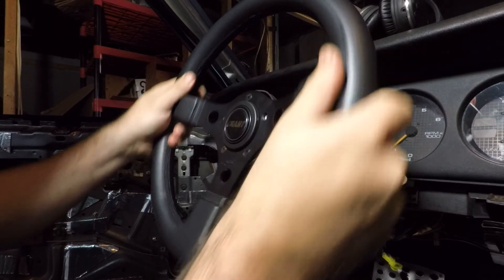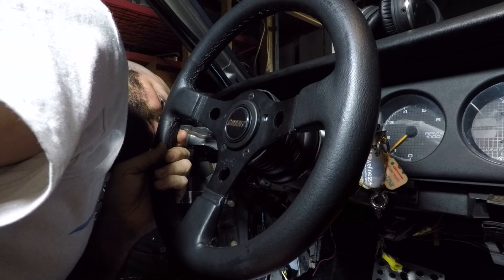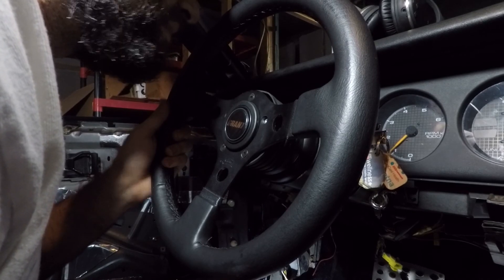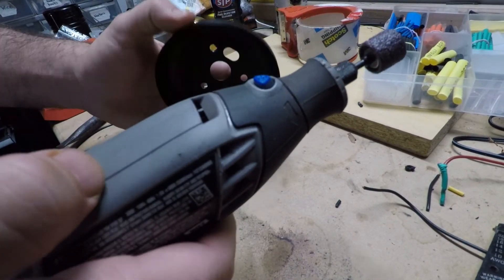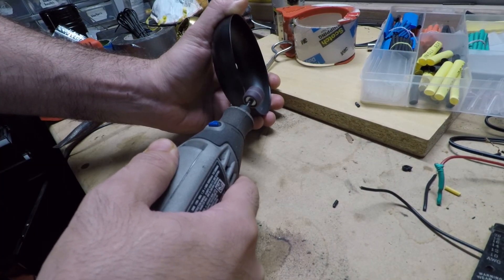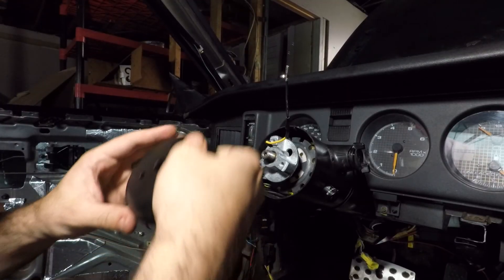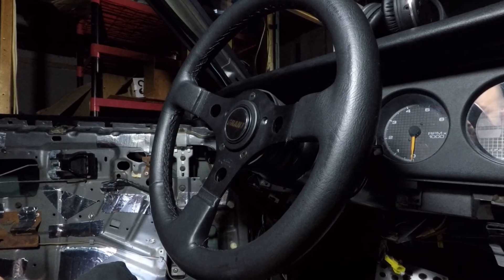This is about when I realized something was wrong — you can see how the steering wheel is very difficult to move. It turns out this cover plate, though it's the correct kit for this application, is just about an eighth of an inch too thick. So using a Dremel tool, I ground it down, then reinstalled it and I was good to go.